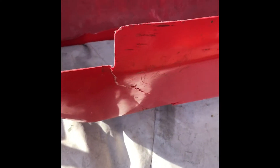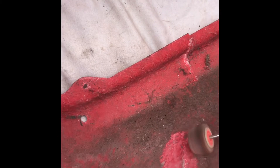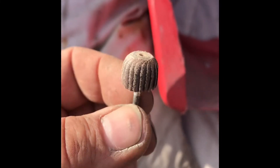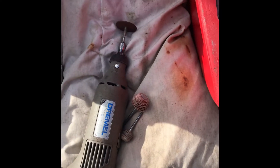I'm going to do a little cleaning up and see if I can get the first bits of fiberglass ready to go. You can see the initial cleaning I've done in this area. I've been using these two tools — the sort you might use to polish a cylinder head if you want to remove material or clean up areas. Now I'm going to change over to the tool I mentioned earlier, screwed into the end of the holder, to cut the actual crack line out and get the panels to line up properly.